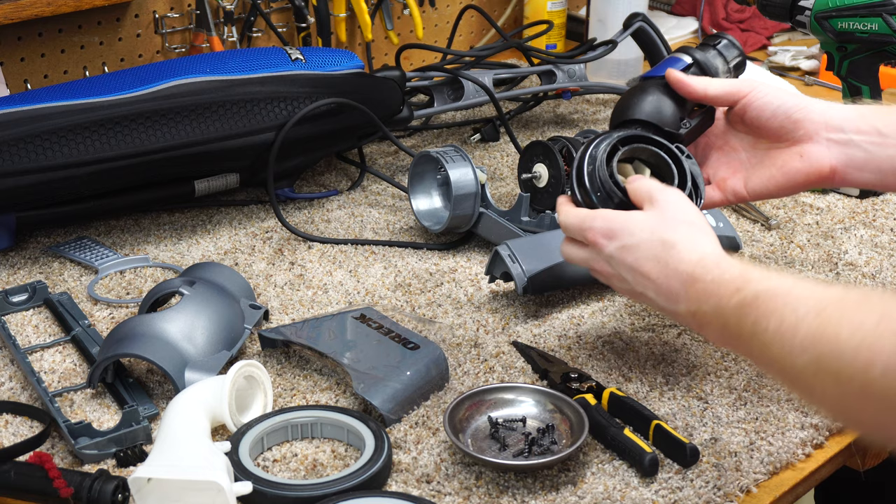The cover should just clip into place. You might want to make sure this is moving freely. We're going to put this cover on right here. There was actually nothing wrong with this particular unit — this is just taken apart for demonstration purposes. I'm going to put the rest of the screws in, and you should have two left over — I'll explain those in a minute. Don't over-torque these; they don't need a lot of torque. With the older magnesium-bodied ones you could torque them a little bit more. Just make sure the gasket is good here, which this one is.